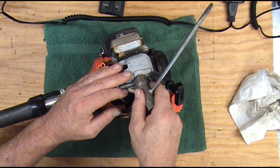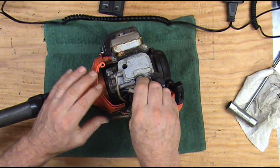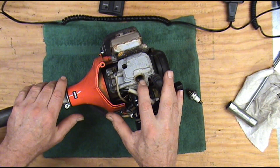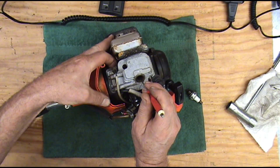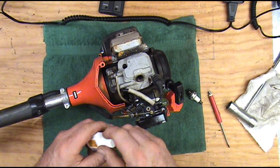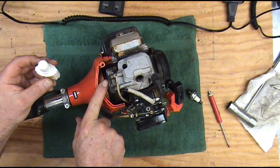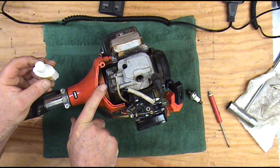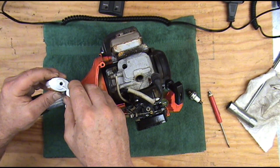What we want to do is take the plug out because we want to find the exact top dead center on this piston. We're going to roll the flywheel around until we get the piston all the way to the top. When we find that spot, we're going to take some white-out and put a mark on the flywheel, and then put a mark right beside it on the ignition coil. That way as the flywheel is going by we can check it.